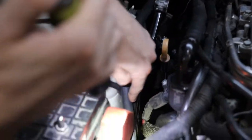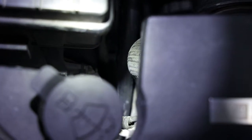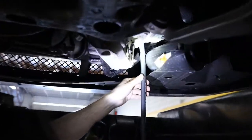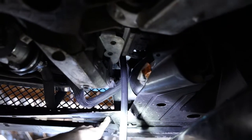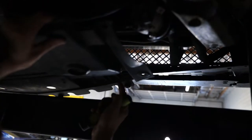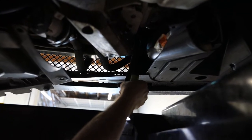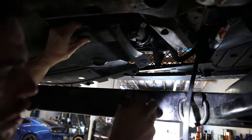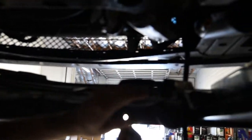The drain line runs down in a loop, goes right by the radiator hose and forward, and comes out along the side of the car pretty much in line with this fastening hole. There is a hole in the panel just a little further back. I'll run it through that hole when I put the panel back up and cut it so it hangs about an inch below the panel, so you'll have some extra hose.